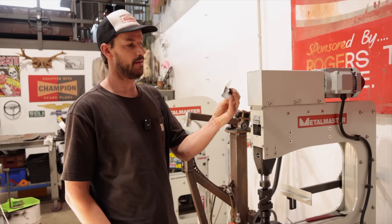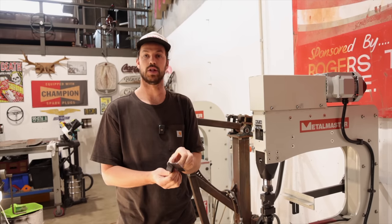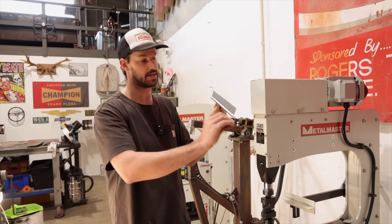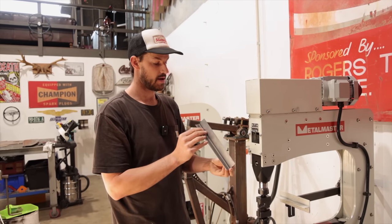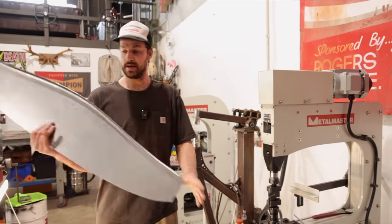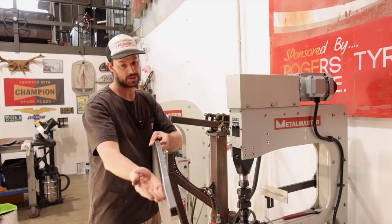To be honest, I could probably modify it slightly to make it a bit larger or something, but this looks really nice. I think that would look quite good as a bottom swage or bead line that goes along the bottom of the dash. So I'm really pleased with the way that looks, and I think it's going to look really cool. What we've done is I have just run this through the shrinker and stretcher, and I've put a straight edge on it to try and get it as close as possible.